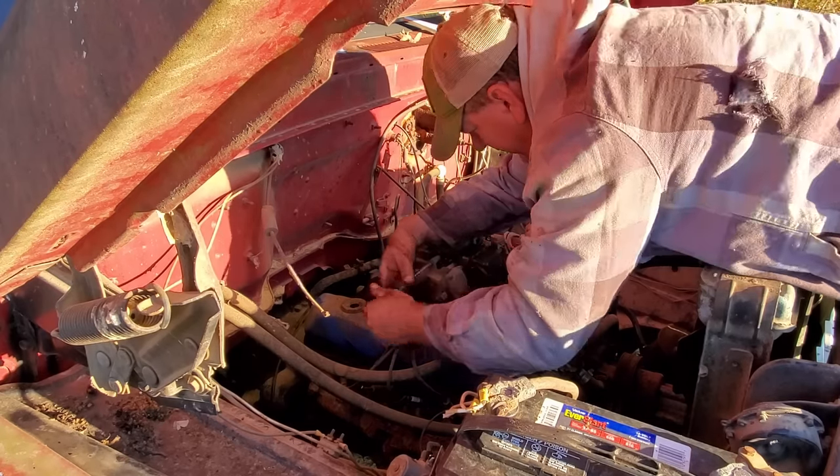Well, it's the next day. The carburetor soaked overnight in the chem dip and it did really good on this part here, but the fuel bowl, well, she's still pretty nasty. That corrosion there, that's from water. I don't think I've ever seen a carburetor that dirty, that nasty. And two, I've never seen that much water coming out of one. I don't know where it came from. Like somebody poured water in a gas tank and said, hey, let's run it.